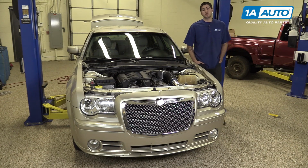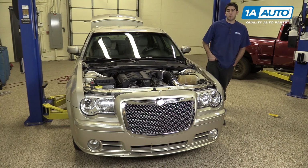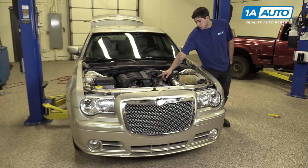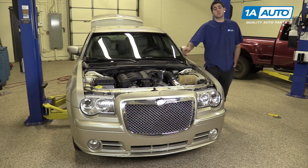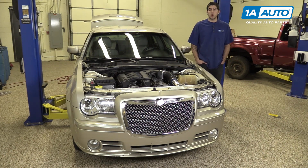In this video, we're going to show you how to remove and replace your engine spark plugs. If your vehicle only needs cylinder 2 or cylinder 4 replaced, this can be done without removing the intake manifold. However, if you need to replace all 6 or one of the other 4 cylinders, we'll show you how to remove the intake manifold in order to access those.